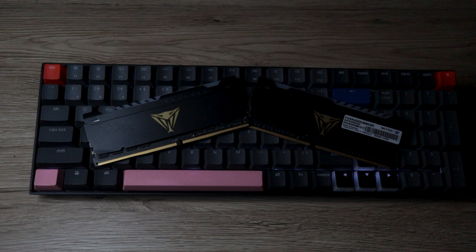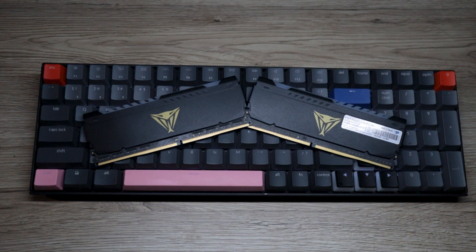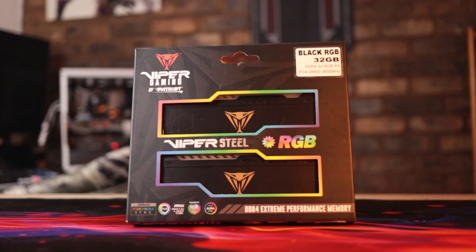So with all that said and done, it's probably time to draw some kind of conclusion. While my first experience with a Patriot product was a pretty good one, and I look forward to checking out some of their other gear, I can't wholeheartedly recommend this particular kit. It won a lot of points in the looks department, and a heck of a lot more due to its great price point, but I just can't overlook those loose timings. Yes, with competent manual overclocking you could get higher results than I was able to get, but most people buying this kit will just slap on an XMP profile and call it a day. And as the numbers show, doing that might not even get you the same performance as a slower and even cheaper kit, even if said kit doesn't look nearly as good. That said, if you can find the Viper Steel RGB kits with lower latencies selling for around the same price as this one, then absolutely go for it.